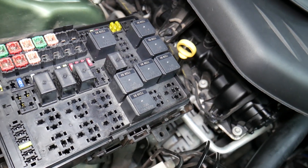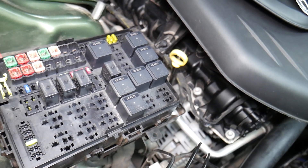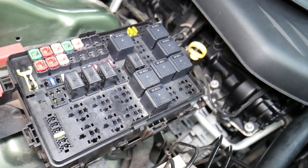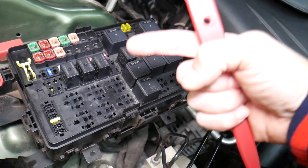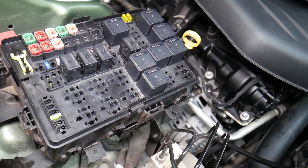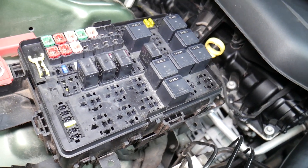For certain fuses, it's important to disconnect the car battery when removing them, otherwise you can burn the electronics. For instance, when working on airbag fuses or anything like that, you need to wait at least one hour after disconnecting the car battery. If you're not qualified and certified to work on the airbag system, I'd never recommend doing that. Also, a common mistake: it's important to know which battery terminal you disconnect and reconnect first — if you do it the wrong way, you can burn electronics modules. We know because we burned a traction control module on a BMW that cost two thousand dollars. We'll put a link in the description below on which battery terminal to disconnect first.